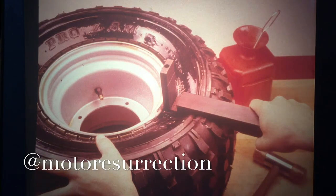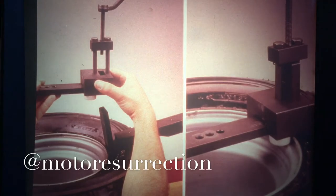Press down on the sidewall so the lubricant penetrates the bead area, and be sure to lube where the breaker arm contacts the sidewall. Hold the breaker arm assembly at 45 degrees and insert the blade between the tire and rim. Push it in and down until it's horizontal — the press block should contact the rim. You may need to tap the breaker arm with a mallet for the last three millimeters; don't hit it hard or you'll ruin the tool.